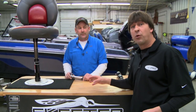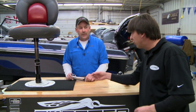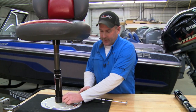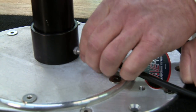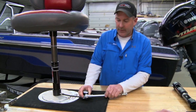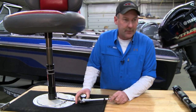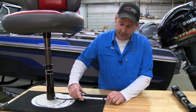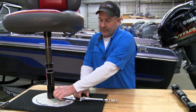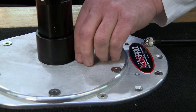What we've got inside the Wave Pro is basically an adjustable shock, and you do that through air. Why don't you show us how that works, Lee? We use this little bicycle hand pump — take the Schrader cap off, screw the hose on completely. You can tell when it's on there because the gauge will move. We see it went to 25 pounds. Add air — 10 pumps — it's 35 pounds. Let the air out; there's a little release valve here. When you're done, just release the valve and screw the cap back on.